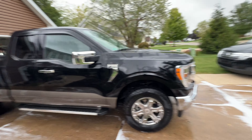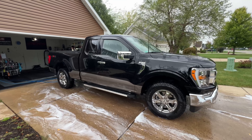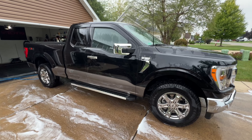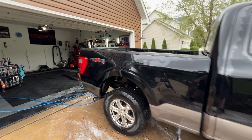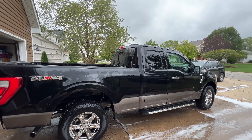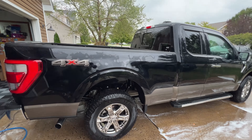There's a lot of chemical and soap going on the driveway — the neighbors are going to think this dude is running a professional-grade semi-tractor trailer truck wash over there. Very messy, but the climate was perfect today so I don't have to worry about anything drying. With those strong acidic at a pH of 2 and an alkaline of, I think, 12 or 13, you don't want any of that stuff drying on the vehicle at all.